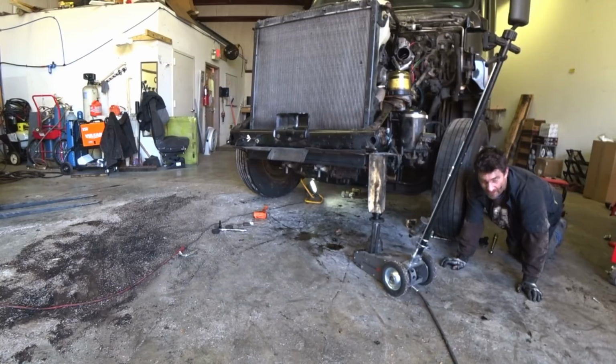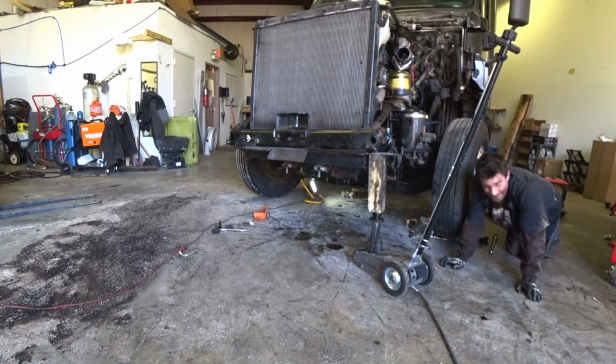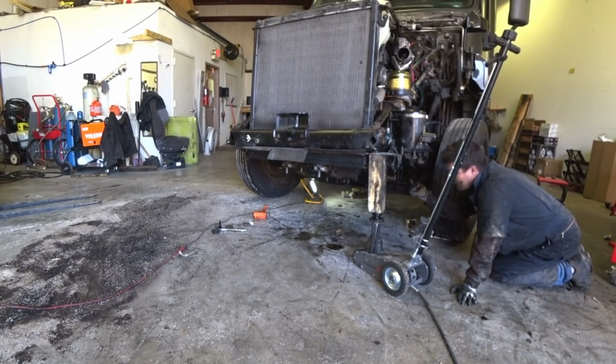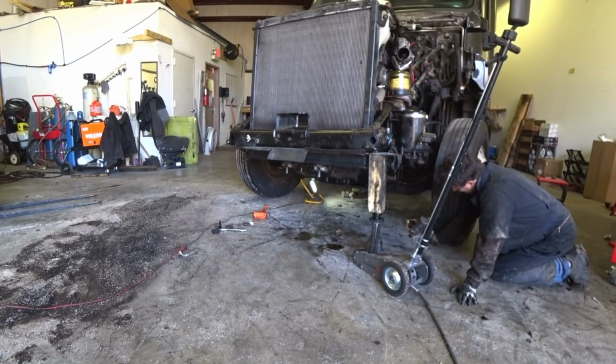It's got four bolts holding it for right now. I got to clean all the other bolts up. We're not putting new bolts in. I know some people say you should. Some people say you should put all new bolts in it because you got these rubber deals on the seal. They're fine. But I'm going to put the rest of the bolts in there. And then you torque them up 33 foot-pounds. And what you do is you start with the corners, and you go to each corner, and then you basically go back and just go all the way around them. And it's 33 foot-pounds.